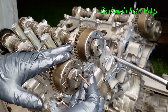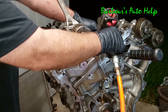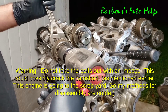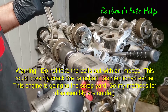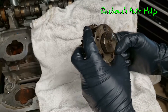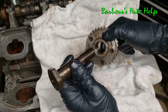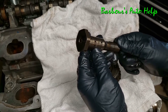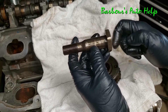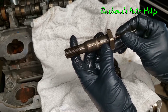We're going to take these apart in just a second and look at the innards to get a better understanding of how these things work on the inside. So this is the intake phaser or VVT unit, and you can see this bolt here is not actually a bolt — it's more like a spool valve. You can see it's got these many holes in the side of it, and it fits up into the unit. Whenever you push in on this part of it, which is what your actuator would do...